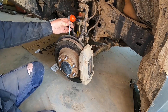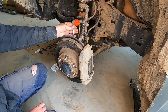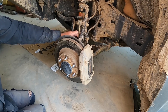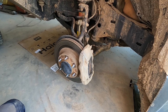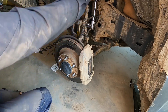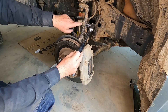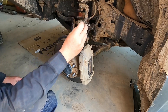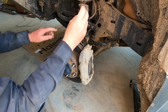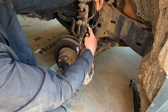This is the left side — big bolt to the top, small bolt to the bottom, same as on the right side but obviously the other side. These ones have got perished rubbers, the same as the other side; they're all ripped. They shake around when you're driving — sounds like a heap of rocks caught up on the bash plates. That was turning at the beginning but seems to have stopped. It's starting to turn again, so I'll need to use that Allen key. Sometimes you'll need to clean all the mud and dirt out of the end of the bolt so you can get the Allen key in there.